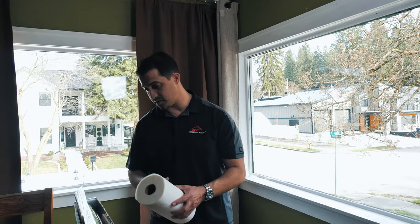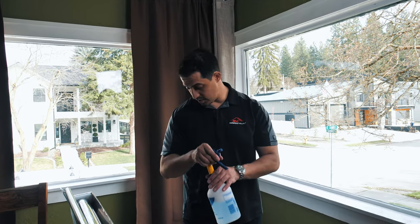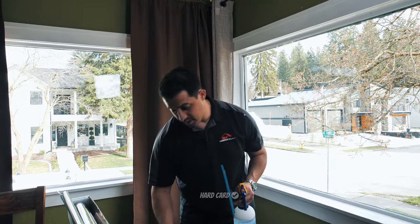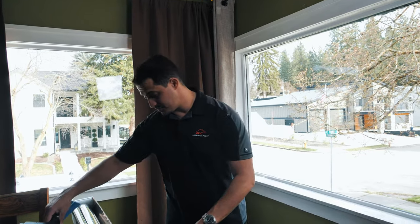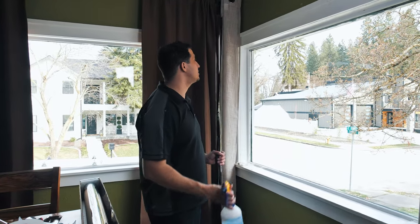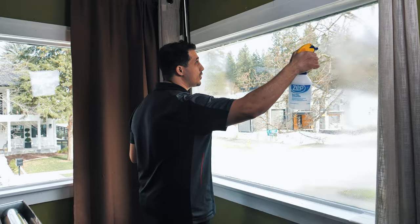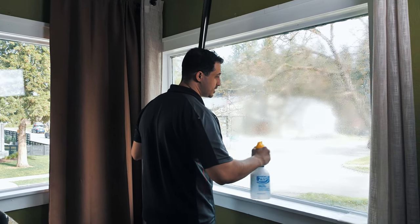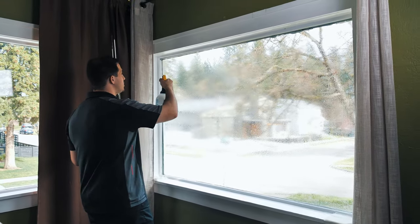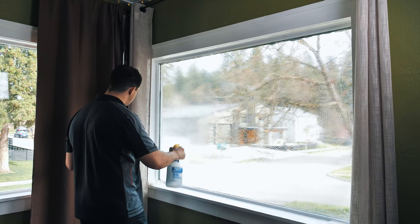We're going to start our installation process. First things first, make sure you have all your tools laid out and ready for you. I've got my film prepped, my water prepped and ready to go. I have my installation squeegee on hand and also my hard card squeegee on hand. I've got some paper towels cut on the side — that's what I'm going to use to bump the edges. First things first, I like to have the film in hand. I'm just going to spray my glass lightly all the way around and try to avoid the first two inches because that's how contamination drops into your film. Just stay here — don't go all the way to the top.